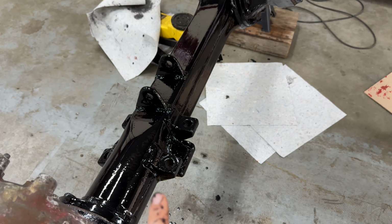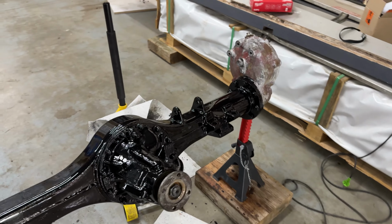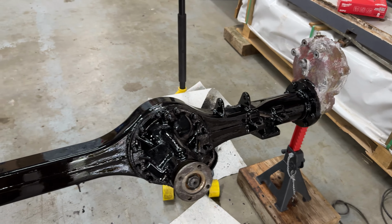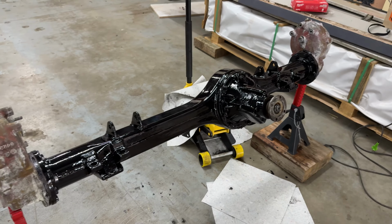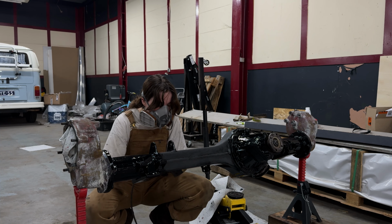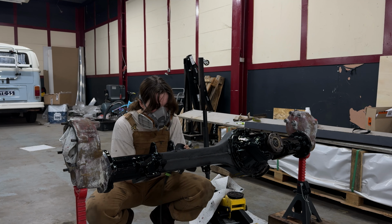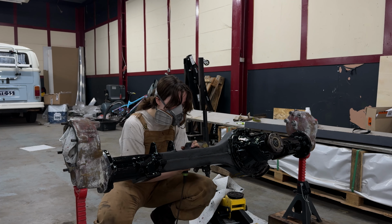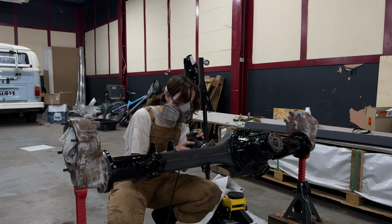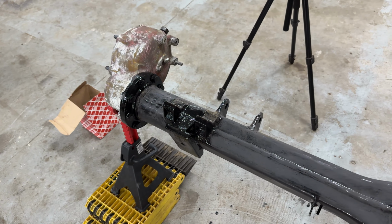But before I'm gonna put the top coat on, I'm gonna lightly sand it with 320 grit. It's probably overkill, but I'd like a really smooth finish. I'm a tad perfectionistic. I then lightly sanded down the axle. This will remove any impurities or unevenness and it will also make the top coat adhere better. I'm done sanding, now the top coat can be applied.